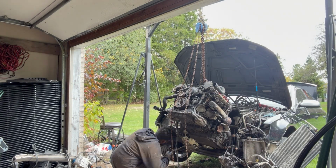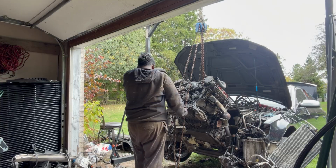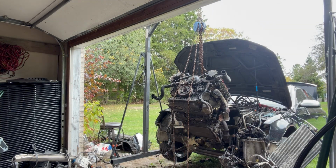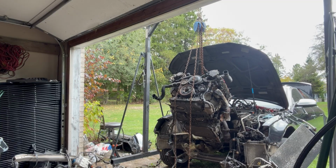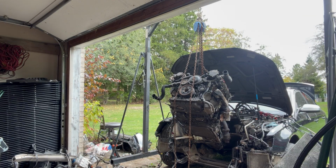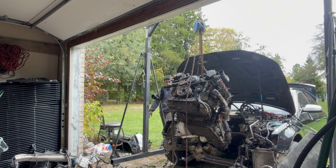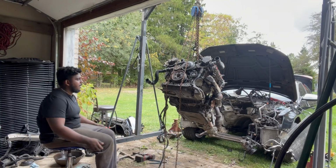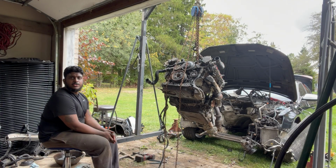The two would go right between the cross member section. It's just two long 17 mil bolts. You just take them out. And then the inside one is an M14 triple square. At this point, when I had the engine fully out almost, I just ended up lowering the car and pushing the car all the way back out, so it just freestands the engine. And she's out.